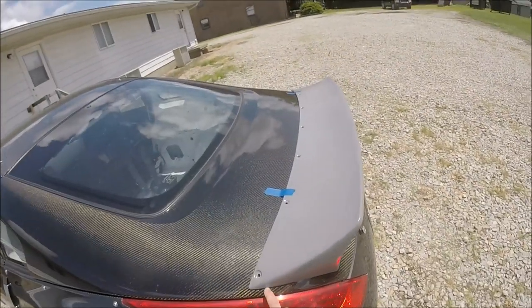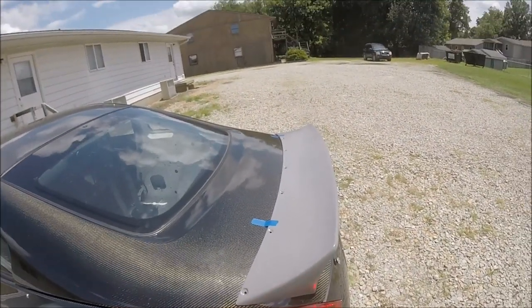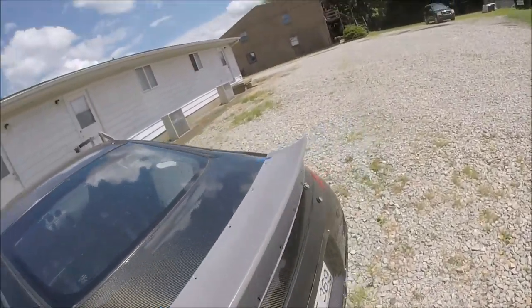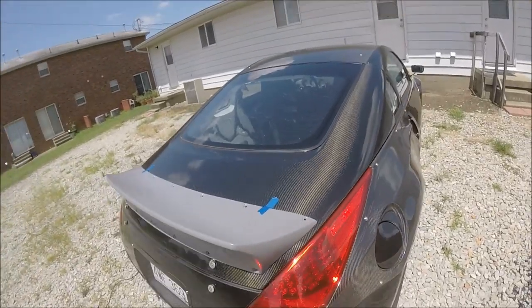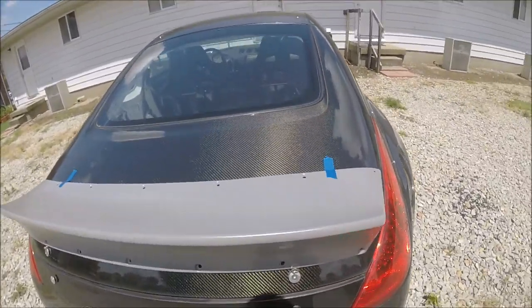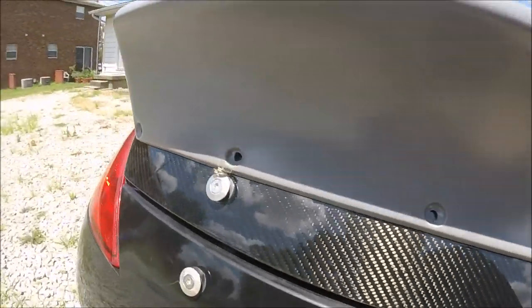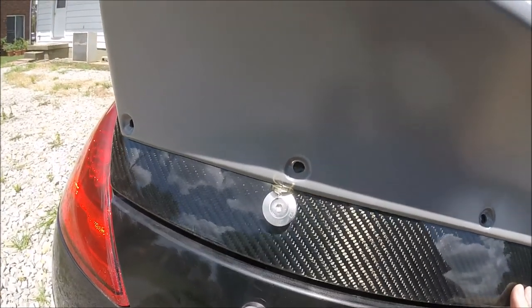Fast forward through the weekend to Tuesday — it was just way too hot to do anything. But it's high 70s now so let's get out and get to work on this wing. This was incredibly difficult to do by myself, trying to position it back and forth to get just the right distance. I got some tape holding it, I've got the perfect distance on both sides, and I'm using little washers to give a nice consistent gap from the quick releases.